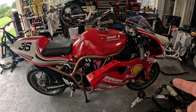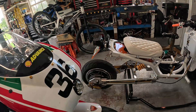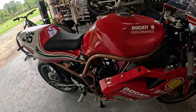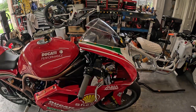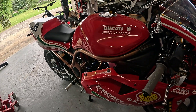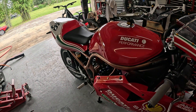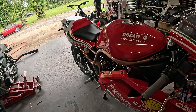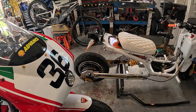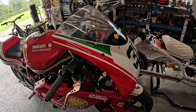To summarize: both were tuned for zero to 60 on the controller with no field weakening — which disadvantaged the mid-drive but didn't really matter for the hub drive given its high RPM. The mid-drive was surprisingly quicker in 0-60 when weighted equally, and the same in the eighth mile — just with a slower top speed, which I think we can work out by playing with ratios and field weakening. As far as rideability, the full-size bike rides way better, but I don't like riding a bike with this much power and no clutch — it takes away the fun factor. Tough call. I guess I like them both.